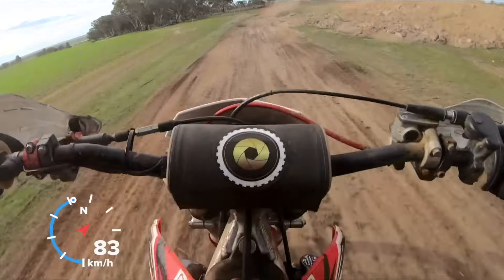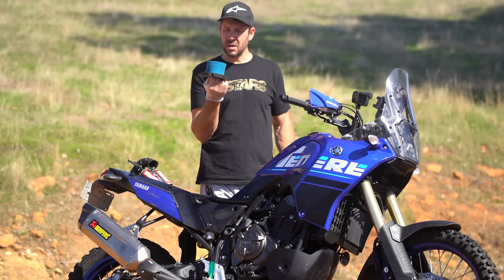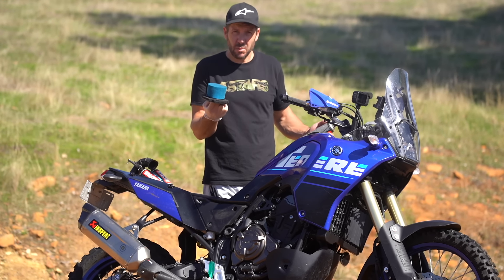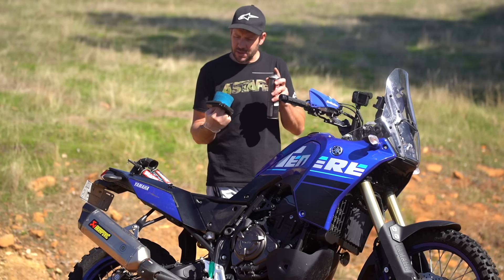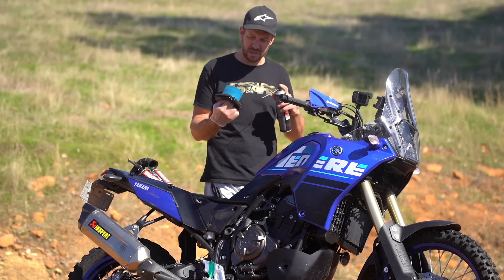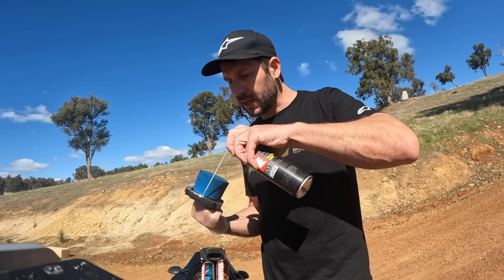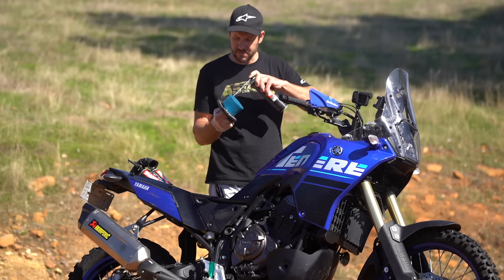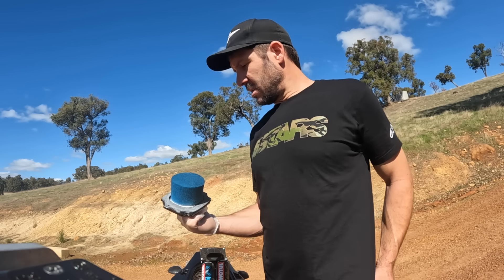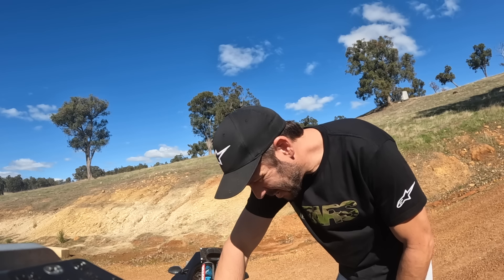So now that we're clear on that method, it's exactly how I clean and prepare the T7 filter. There's absolutely nothing wrong with this — freak out if you will — but I'm just putting it back in because it's not even ready to be cleaned. One thing I always do first: some people just coat the foam with grease, but I like to use chain lube. It dries like a super tacky seal, it's very accurate and clean, and you can put as little or as much as you like. It's just an extra seal. Another thing I've been doing forever — cross countries, racing, the T7: the secret with air filters.